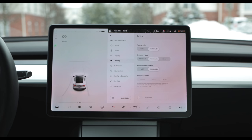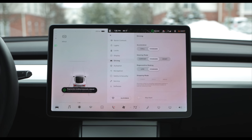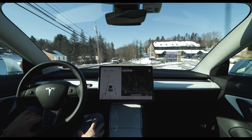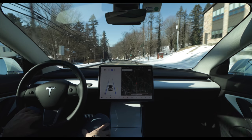First, I want to walk you through the settings you'll need in order to enable one-pedal driving in a Tesla. You'll want to make sure you have standard regen turned on — if you use the lesser setting, regen won't be strong enough to slow the car down. You'll also want to make sure that your car is in hold mode, which means the car will come to a complete stop and then automatically engage the brakes to remain stationary, so you won't have to hold the brake pedal like you typically would in an ICE car while idling.